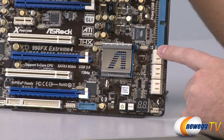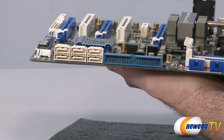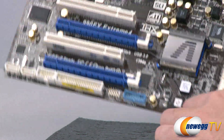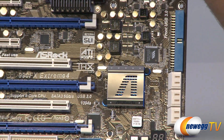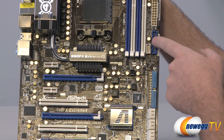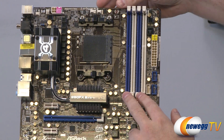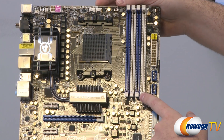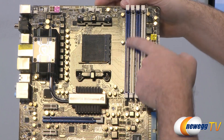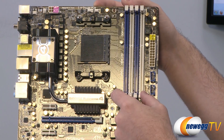The SB950 Southbridge chipset controls the side-facing serial ATA ports, and again all of these are SATA revision 3, 6 gigabit per second. Here you also have your IDE port so you can use that IDE ribbon cable for older IDE devices. Moving up the side of the board, we have USB 2.0 pinouts for front-panel USB 2.0 ports, a firewire pinout, our 24-pin standard motherboard power connector, and then the DDR3 slots. This supports dual-channel DDR3, up to 32 gigabytes, with DDR3 speeds of up to 2100 MHz supported — that's an overclock speed, but you can bump it up there if you desire.